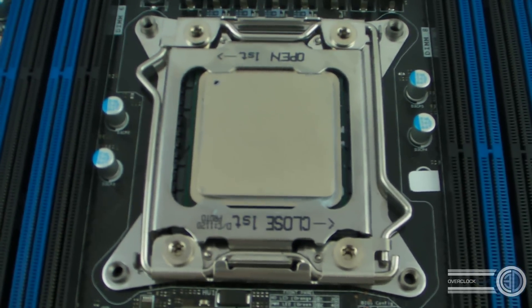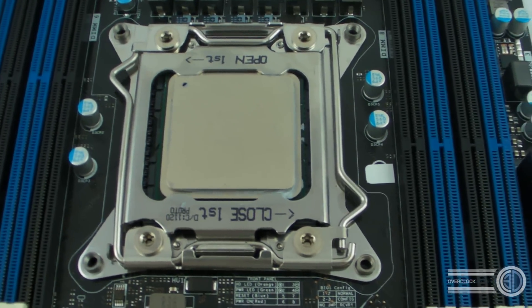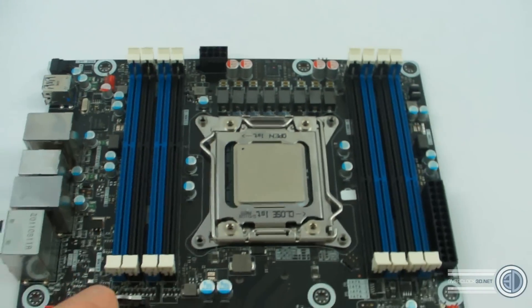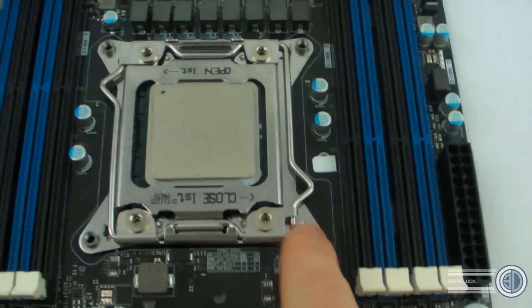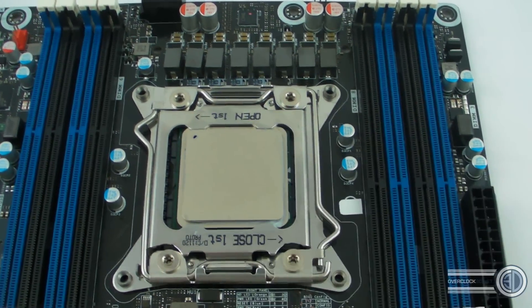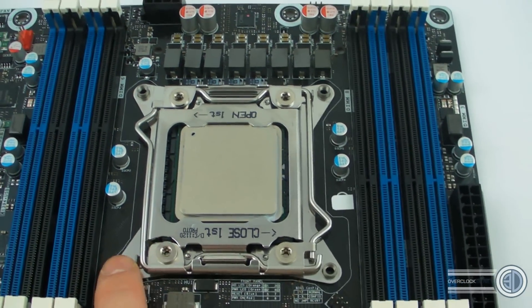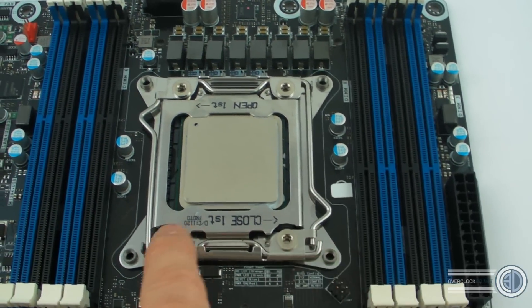With the standard Intel design you've got to use these threaded points. ASUS, for example, have a slightly different way of mounting theirs. If I turn the board over, there is a much larger back plate. The idea is that with the larger back plate and the screw-down points, there's much more rigidity — it keeps the board nice and straight because the CPU is actually significantly larger than before. It also has a double retaining mechanism. These mounting points are the same distance apart as a 1366.